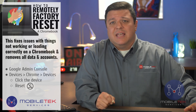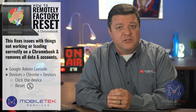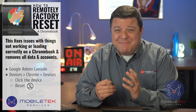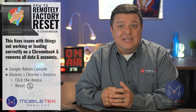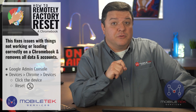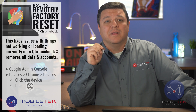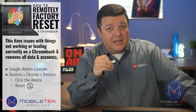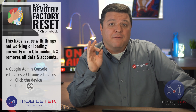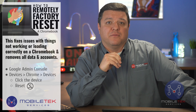There are also two other types of resets you can do on a Chromebook, but you can't do those remotely, which is the topic of this video. One is called a hard reset, which resets the trackpad and touchpad and reboots the device — a great fix when a user says their trackpad has stopped working. In my case, this works about 50% of the time, and if it doesn't, there's a good chance the trackpad is damaged or the little cable inside is loose. The other is called a factory restore, which is just like the factory reset in this video but also reinstalls Chrome OS. I used this all the time as a tech director because I could perform this function with a thumb drive — I carried a mess of thumb drives on a key chain, one for every flavor of Chromebook I supported.